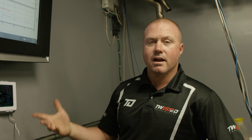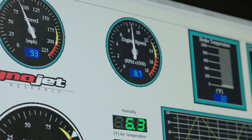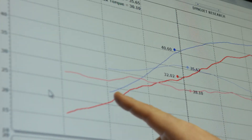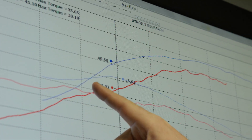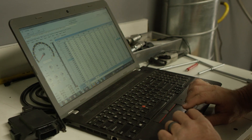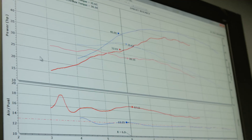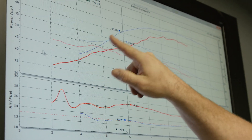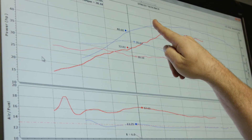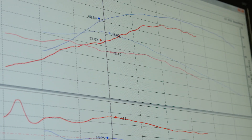The smooth power line in our opinion is simply the result of getting the air-fuel ratio right — it's making more power, it's going to connect and be smoother out of every turn or every bump. You can see that sometimes leanness will give a little wiggle, but when we fill in the fuel curve we get a nice round line. If you had a big hole in the mapping between, say, five and six thousand RPM, or if the curve was steep and then came up, that's what would feel like a hard hit. But this is just going to pull real smooth, real hard, and real predictable.